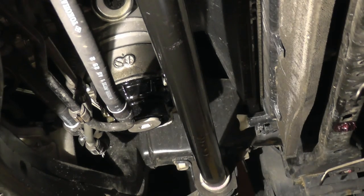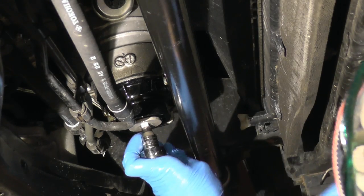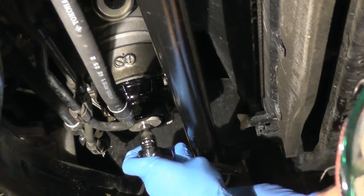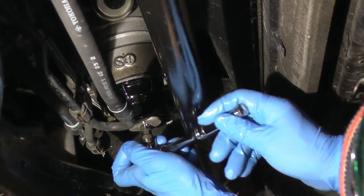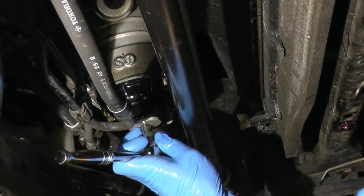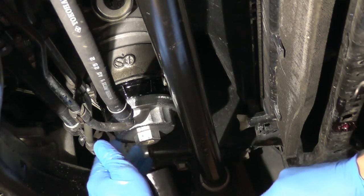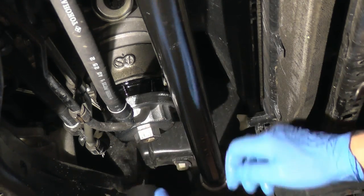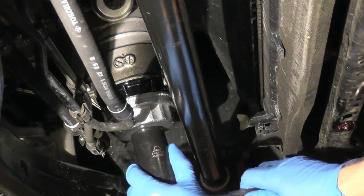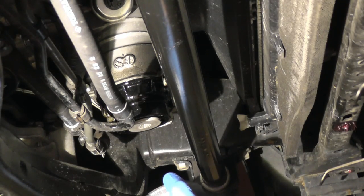Now I'm going to make sure this is all the way in. I don't want to have any surprises. And like I said, what holds it is not how tight it is, it's the seal itself. So I'm not even applying too much pressure. I'll double check. That's it. So it's all perfect, perfectly sitting. It's not like your conventional oil filter that has to be super tight.